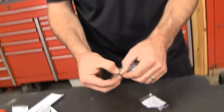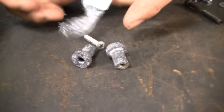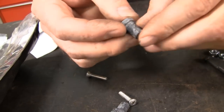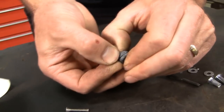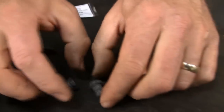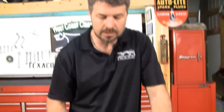Here's another very popular alternative — we'll call it a rubber rivnut. This does not require a tool or a special procedure. Just drill your holes to the same size as this, and being that it's rubber, you tighten it down and it collapses. If you want to take them out later, they come apart. So these are a good alternative.